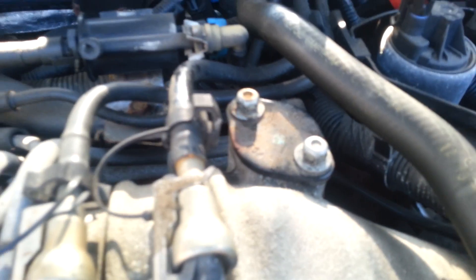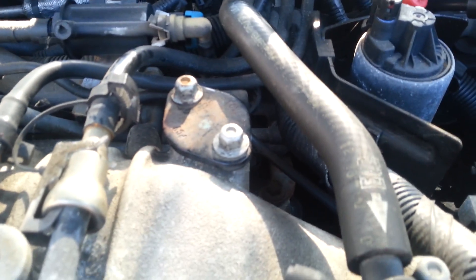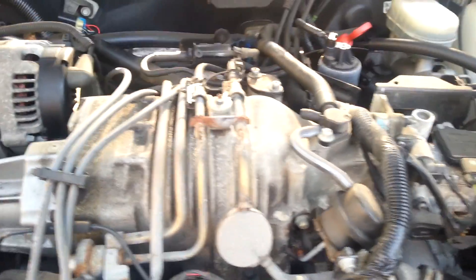PCV valve screwed back down. I didn't change the gasket — I don't think I damaged it that bad. You can change the gasket if need be. Hopefully that helps some of y'all out with 3800 supercharged motors. Next video will probably be on how to add oil to the supercharger — I believe you do it by removing this little nut right here and adding oil inside. But that'll be another video. There you go — PCV valve replaced, old one trash.